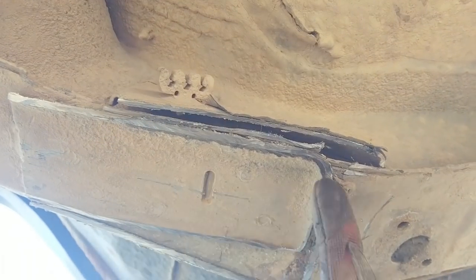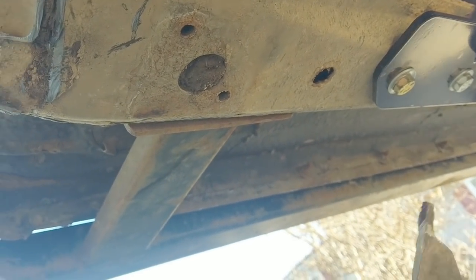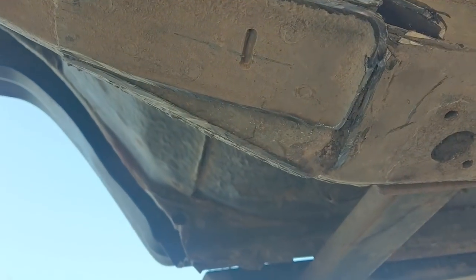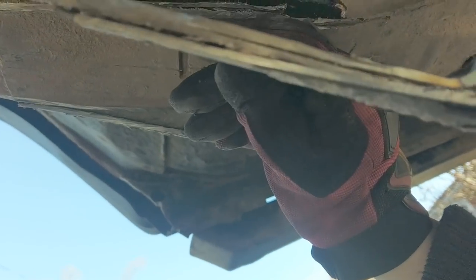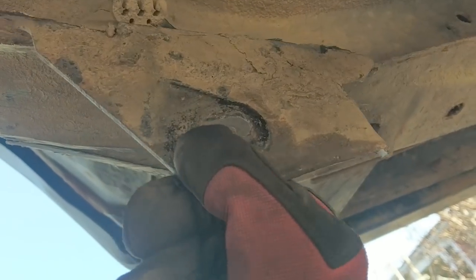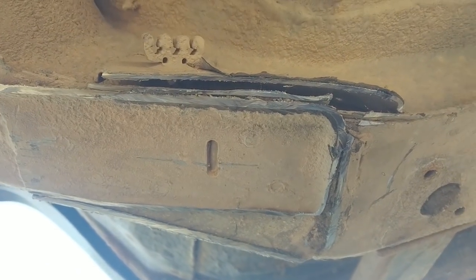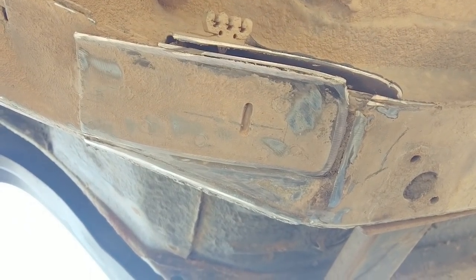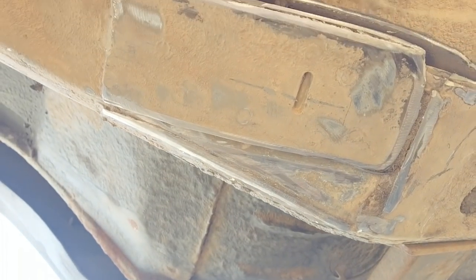She's all free. The trick on this side was cutting on the outside first, then coming inside and cutting both layers at the same time instead of making two or three separate cuts. That's actually a lot of metal — three different plates right there. Clean it up with the grinding disc, then the flap disc to make it shiny, hit it with some paint, and we're done cutting.